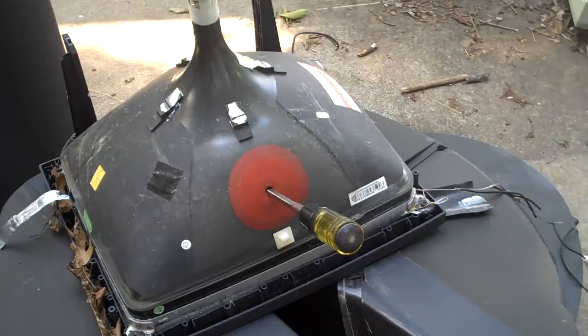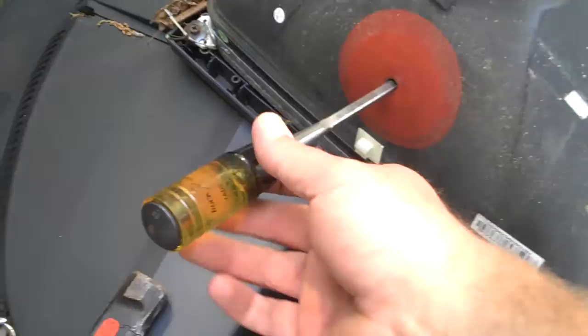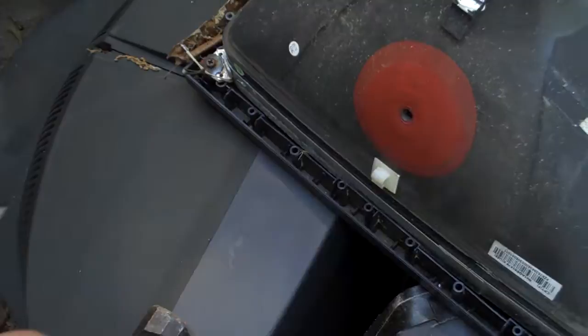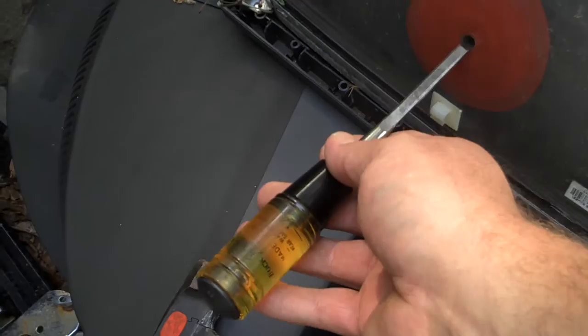I'm going to open up a CRT. And what is this, you may ask? Well, this is where the plug goes. And this is the part I thought I had the camera on and didn't. You just poke a hole in there, and when you do that, you open the vacuum and let the air all back into the tube. You don't have to bust this off to do it. Just give a good whack with a hammer and poke a hole and air goes back in.